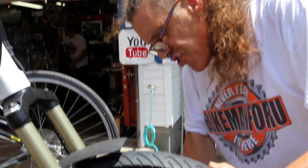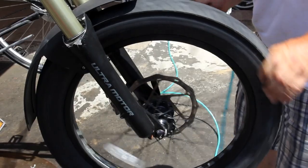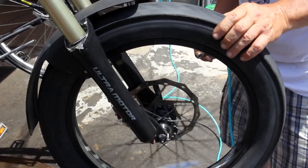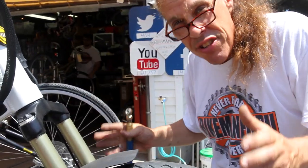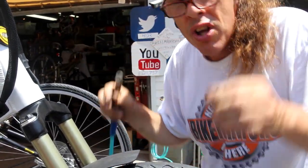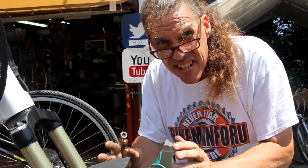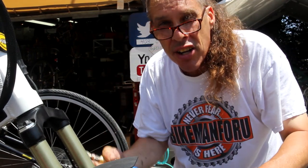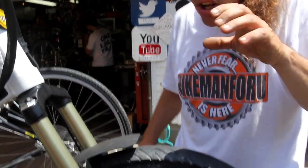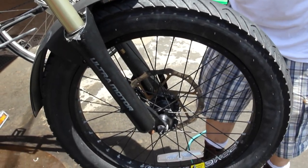The next thing when it's sucking in — this is not if it's blowing off, but if it's sucking in — sometimes going over the maximum recommended inflation pressure to get it to pop out. You might have to do it, but be careful. Look, examine, concentrate, be persistent. Massage it in. Seat the tire on the rim. Usually the fatter it is, the tougher to seat them, but you can have problems with the skinny ones like this too.